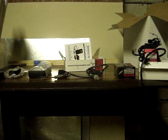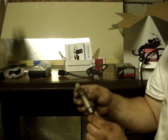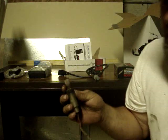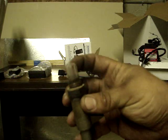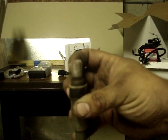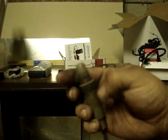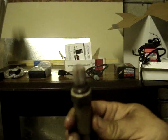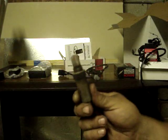I want to start off with the O2s. This is a standard heated O2. If you can see that, you see the louvers in it — the exhaust passes through these louvers, and that's where it gets its sensor reading from. This is out of my '96. You can see it's already running pretty good; it's nice and clean, no black soot.